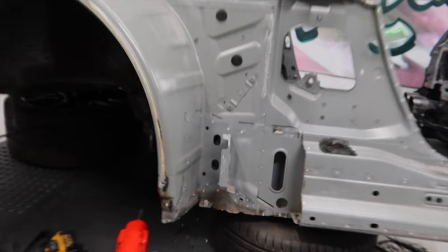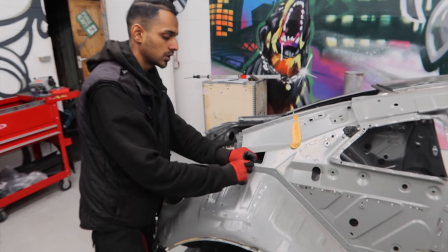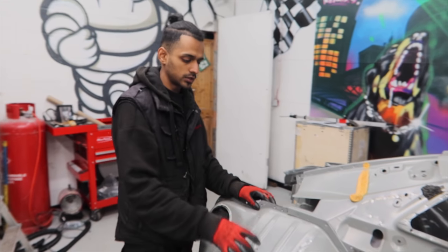Box sections have been removed, you see right there. This piece right here and the outer arch and the inner arch have been spotted all together. So what we're going to do is, we're not using this piece, so we're going to cut all the way around it, drill our spots and get this piece right off. Then we can start drilling again